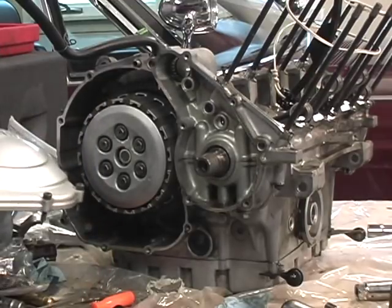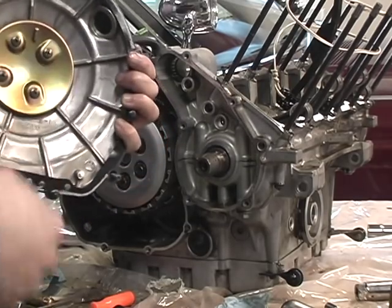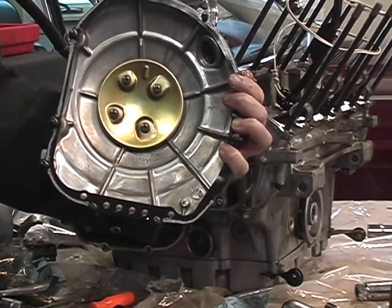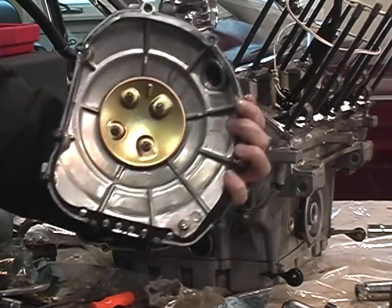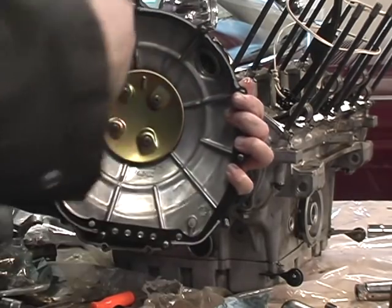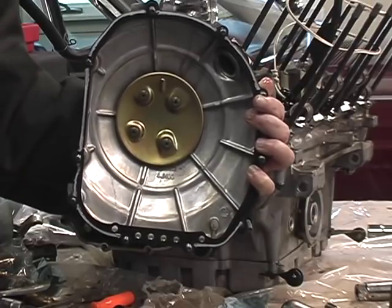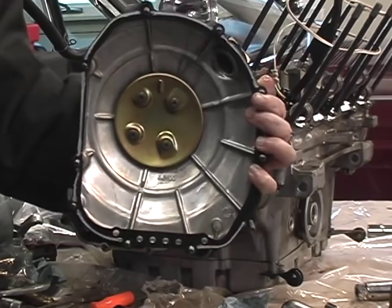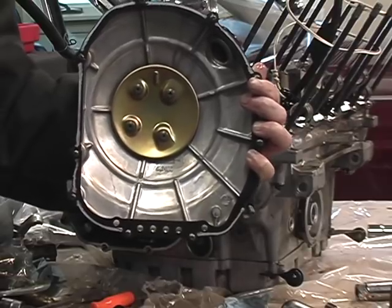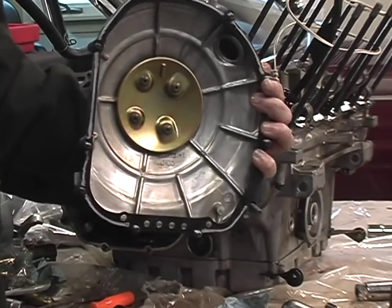Cover and bolts — keep them together. Cover gasket: usually these come off clean and can be reused. I've reused this one a couple of times and I'm thinking about buying another one, but it's still in very good condition. Some people forget the gasket and do RTV around the perimeter — you can certainly do that. I've had this off so many times for different shift shaft replacements, clutch kits, clutch adjustment. This is only my factory gasket plus two, and I've had this clutch apart a dozen times or more.